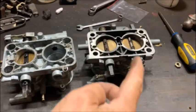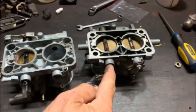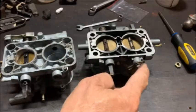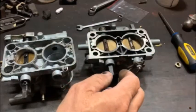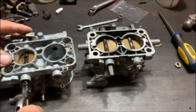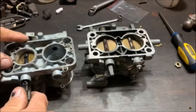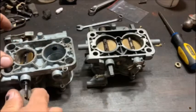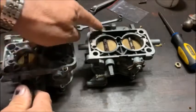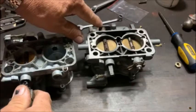So the next challenge is the return spring. This return spring sits on the other side on the 38, and now we've removed all of that, so there's no return spring. On the old Fong Kong 3236, that's where the return spring sits. So I'll take this apart and I'm going to use that spring to put over there. Obviously there's no notch on that one, so I'll have to make a little notch there.